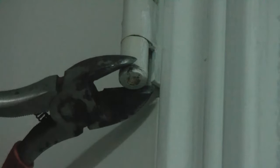Let me zoom in. What I do is take the cutting edge of the dikes, find that little ridge right there where the cap clamps in, and clamp that on it. I basically go around, breaking the paint off around there, because that paint will be like glue — it will stick in there. So I run that around there a little bit until I've got most of the paint broke away and cut in so it will break loose.